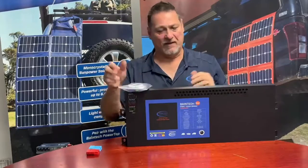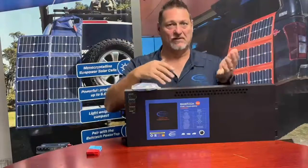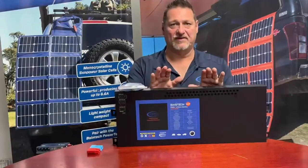Easy to wire up — turn on and off with the ignition — and it takes away all the worries of voltage dropout. We've had people say they had to turn their dial down because by the time the voltage got to the back it was trying to pull 40 amps. We've done this as a CC over CV charging rate, so as the voltage goes up the current comes down. Once you get into that higher voltage it won't be pulling 40 amps — it'll work its way down to where it needs to be.